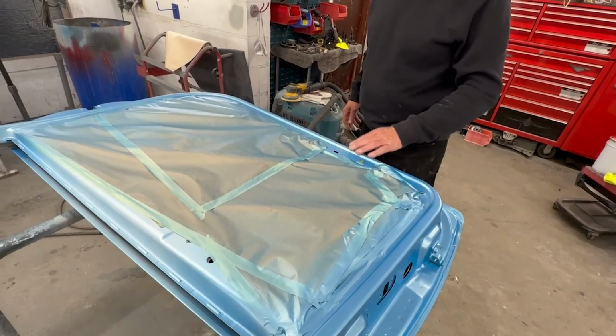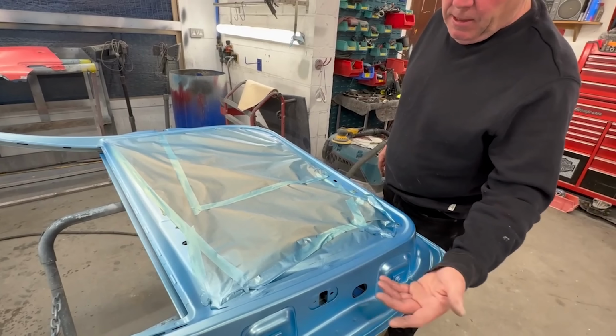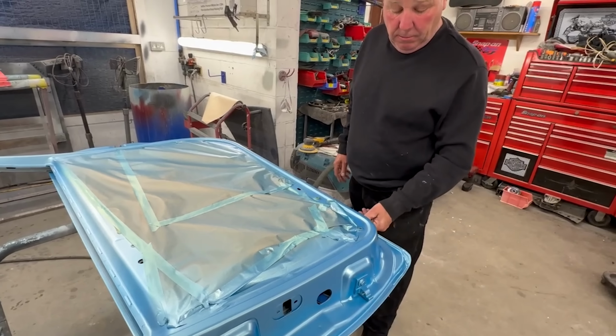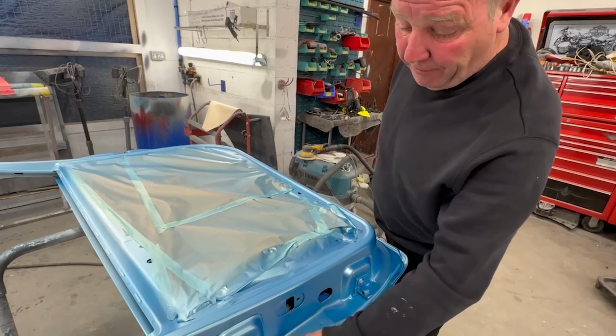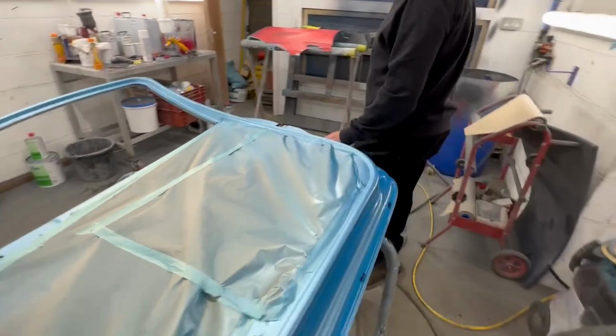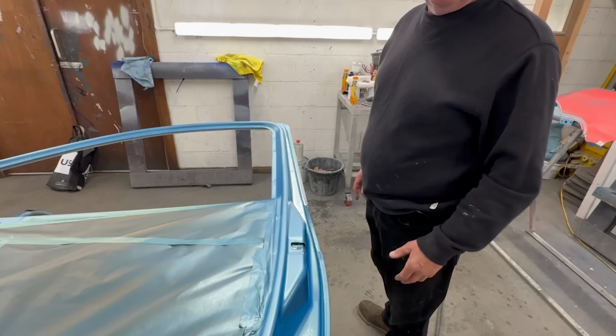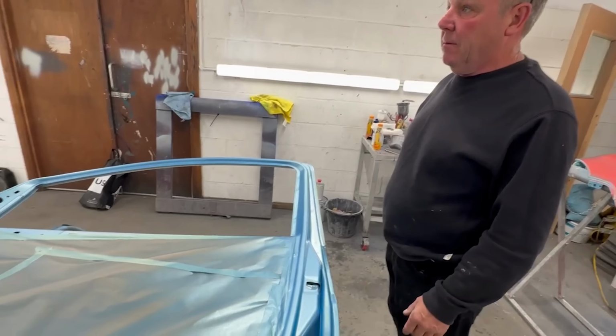Right. Trouble is, to lacquer straight away, or to base coat over the top of lacquer, it will pickle unless you don't hardly put any thinners in it at all. Right, okay. Because it will already react. So basically what you want to do now is just re-go back over it and re-lacquer it. But be careful, it might pickle because it's fresh lacquer.